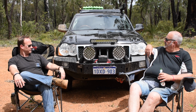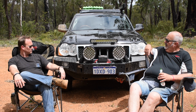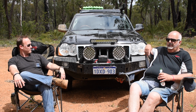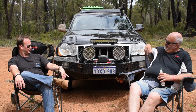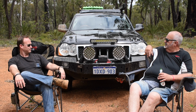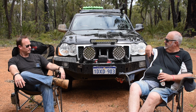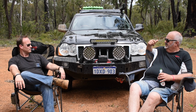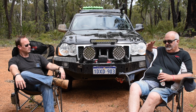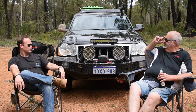Yeah, no, absolutely, Jeeps are renowned for their air intakes being low and downward pointing, or low with an upward pointing cup. And I guess at the end of the day, like you say, it is a tourer, so you're not really looking at bashing through a lot of deep water. No. But there still comes a time when you're faced with that, particularly if you're overlanding, where you do need to cross a bit of a river, and it's nice to know that you can do it with the snorkel. And the other part about it, it just helps you suck some clean air in the Australian outback. Dust is a killer. Particularly if you're in a convoy of vehicles, that snorkel just makes them breathe that little bit easier.